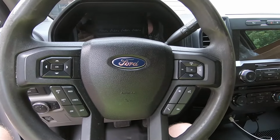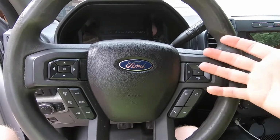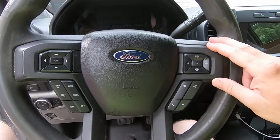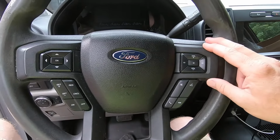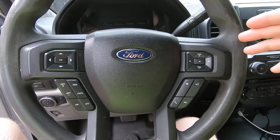Alternatively, you can just disconnect the battery under the hood. I had to pull out my battery to replace it with a new one, and my truck's been sitting here for a couple of days with no battery. So I know that my restraint control module has lost all its juice by now.